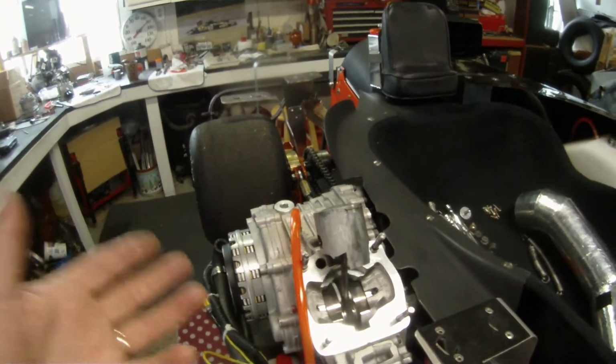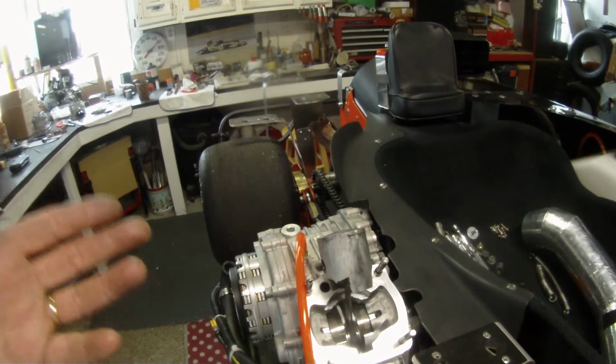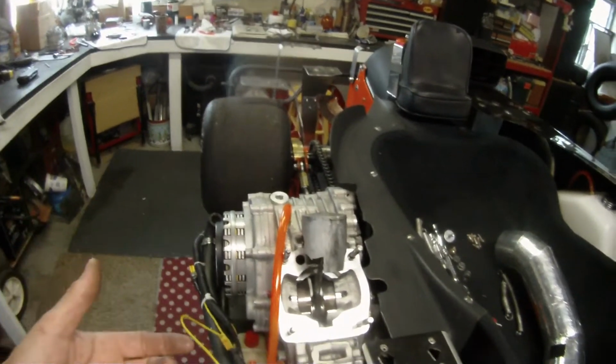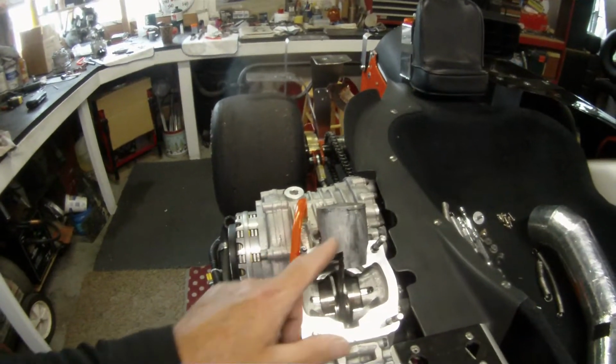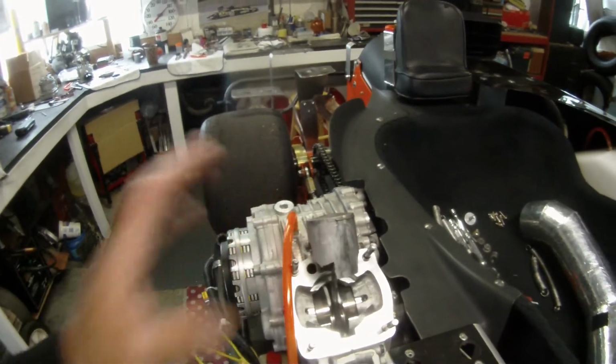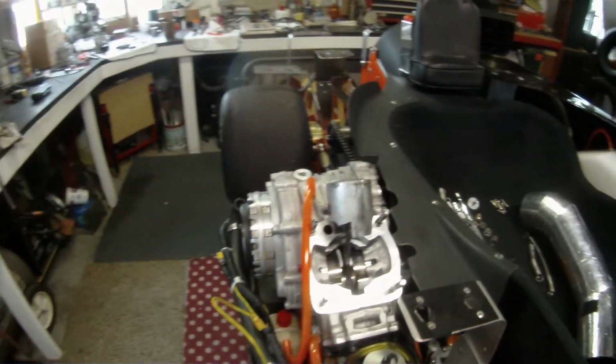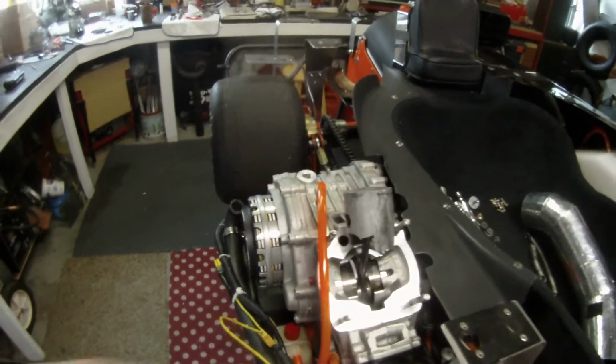You saw the video from Grattan where we lightly stuck the engine. It was really a cold stick. Four stripes, never froze up the ring, still had good compression. We cleaned the piston up, no transfer to the cylinder, so we ran a hone through the cylinder to try to give it a little bit of room. That was on a 5395 piston.